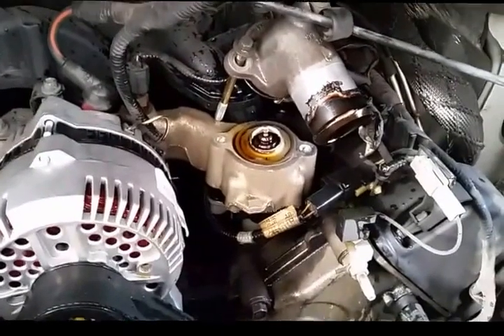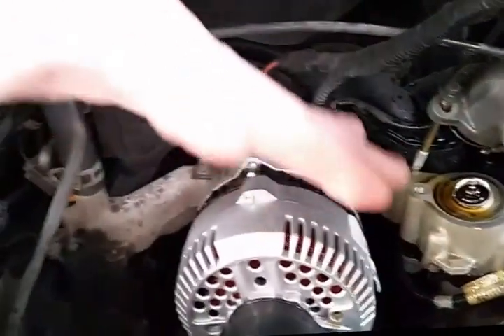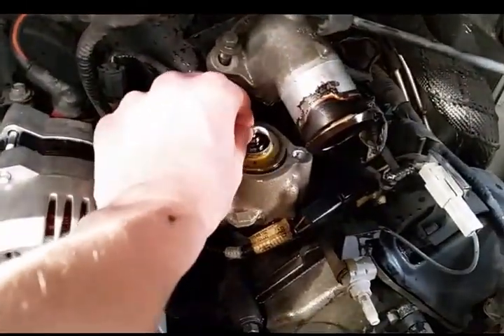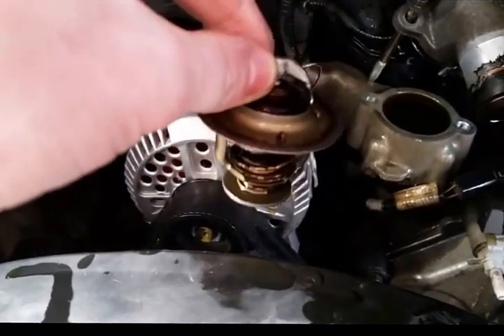Well, we got it off. It's a 10 millimeter bolt on each side, just two of them. We encountered a small problem when pulling this out that I didn't consider: it would be best to put the car on a hill so that the front hood is elevated — that way the coolant would stay up in the radiator. When I pulled this off, any coolant in the radiator above that mark drained out, so we lost a fair amount of coolant and will have to run to the store to pick up some of that expensive coolant after all. Good to keep in mind when you're doing this repair yourself. But there's the thermostat in all its glory right there — I'll show you how it works, compare it to the new one, and then we'll go ahead and finish up the repair.